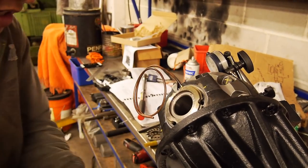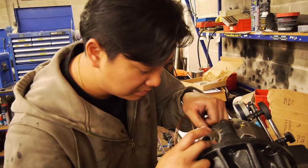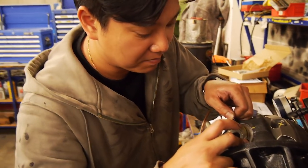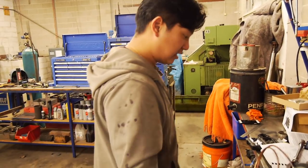But yeah, be really, really careful. There's a lot of stories out there on the net about how air lockers are shit, and they've been back 3-4 times to refit the seal. Definitely, if you have the original O-ring cord seal, get the X section, which is what we've fitted here, and you really have to lube it up and just carefully walk it on. And if that surface is scored up, then of course you're going to have to do something to clean it up.